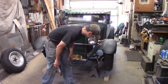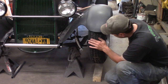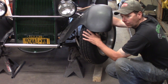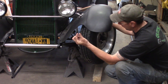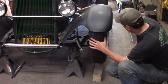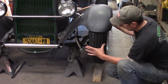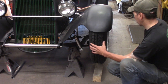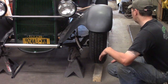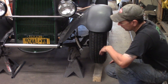Keep Speedway in business I guess, or Coker, whoever makes these. But check this out — it looks good here. I like how the tire's centered up in the fender, and when I turn it all the way to lock I have a bunch more clearance to the fender brace. I can actually get my whole hand in between the fender brace and the tire — before there was only like a quarter-inch gap. I'm still going to trim the fender brace back with the grinder to get some more clearance. These tires are the right choice. I sacrificed like half an inch of tire height but almost two inches of tire width, so they really helped out a lot and they fit my rims — I don't have to buy new rims.